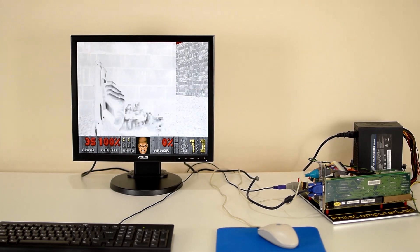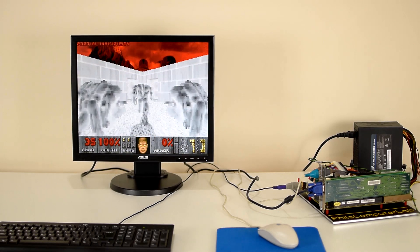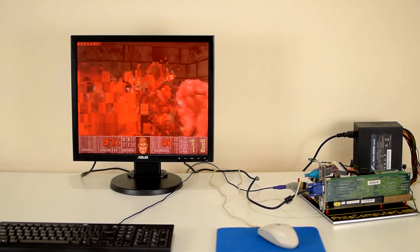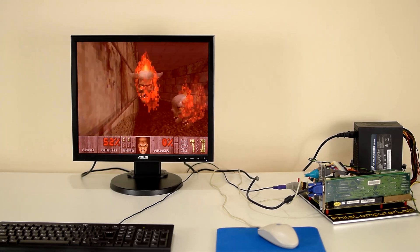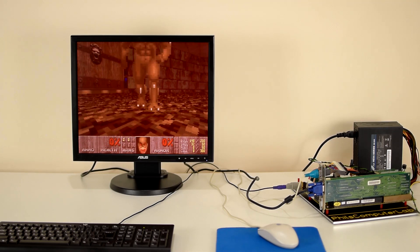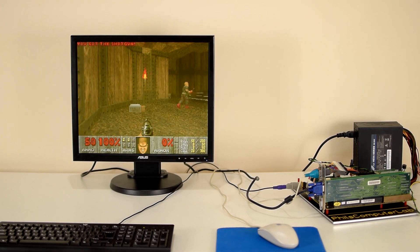Maybe you have to adjust the window a tiny bit for some of the busy scenes, but you'd be a happy camper if you had a DX2/66 back in the day. The DX2/66 that I have is a simple drop-in replacement — it runs off 5 volts — and the Biostar motherboard I'm using does not support multiple voltages like the 3.3 volt that some newer processors support. So it's a very compatible chip, and the BIOS also fully supports it.